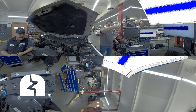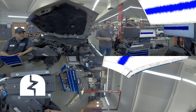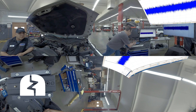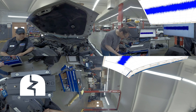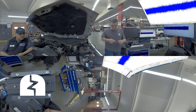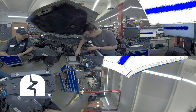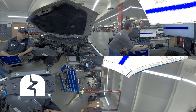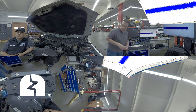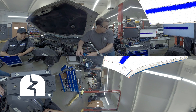For first-time Pico scope or lab scope users, if you see static like that, what does that mean? Well, this thing's auto-ranging. Look at the vertical scaling — 50 millivolts — so it's seeing all kinds of noise. We have to configure what probe we're looking at. In this case, I need one ground clip to find a ground, and lucky for us the battery negative is right here. Then I'm going to turn on channel B. We'll go to 20 volts — this is just a one-to-one probe. And we're going to plug this in.